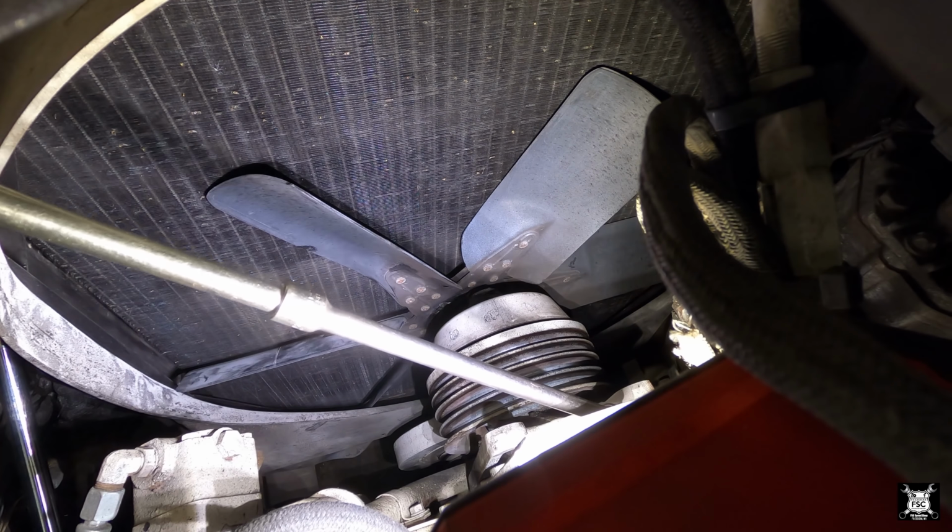I now have the fan clutch sitting on the table. I will show you one other thing that's annoying with this thing. Right here, there's a zerk fitting, a grease fitting. And it's obviously very difficult to get to with it mounted in the truck. It's basically impossible. But what went wrong is here. Right here, this was threaded in and this had broke off. So now I have what's left of this still in the hole. So I'm going to attempt to work an easy out and get it out. If that don't work, well then, we're in for a long day.